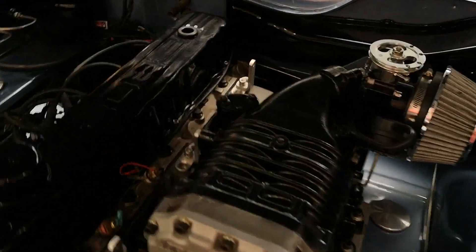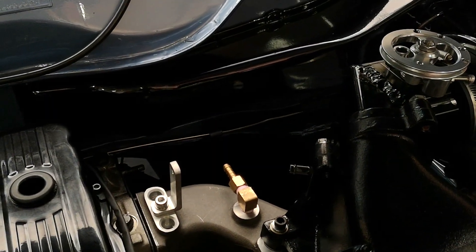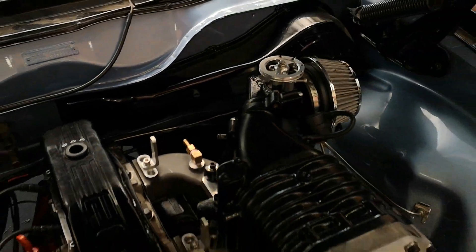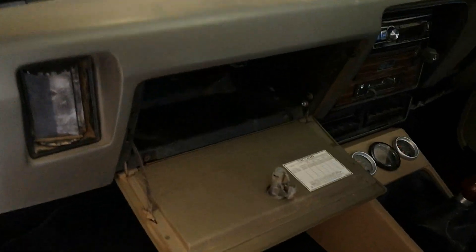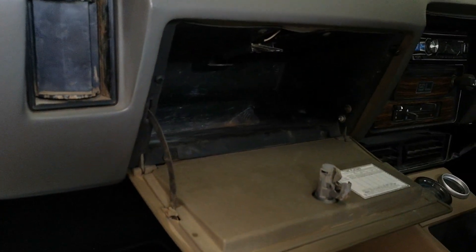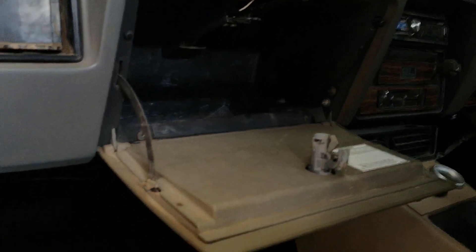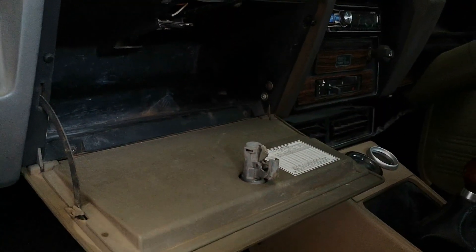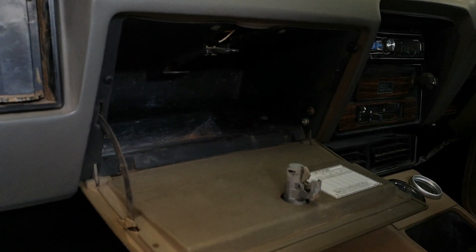Down on my ECU I have the main plug that will go into the harness, connections for accessing the program side of it, and a little vacuum sensor that will hook up to the manifold. I'm going to run a new hole in my firewall, so I'll pull this supercharger back out. I'll have a look around the firewall for a position I can bring it through. I'm going to run from my glove box where I've got access to the ECU. I'll pull that glove box out and look behind it — I've bought a grommet to plug the hole back up.